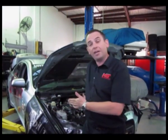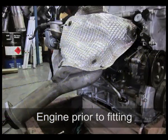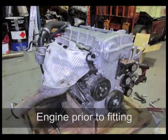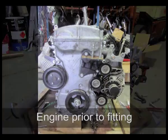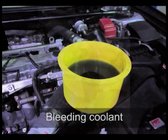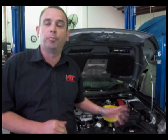As you can hear in the background, the engine is now running. We started up the engine and did all the precautionary pre-checks — oil pressure, bled the coolant as best we can — cranked it over without the ignition connected so it won't fire, to build oil pressure first. The engine started first time, which is something we're always grateful for in a major engine rebuild. You can see the special container attached to the radiator cap to bleed up the cooling system — a lot of people don't understand how to bleed a cooling system in a modern car correctly, and on a Subaru it's vital to get all the airlocks out.